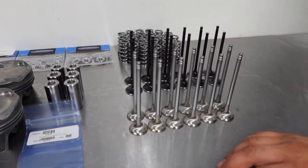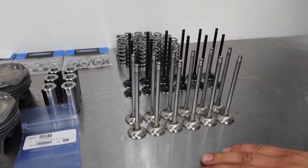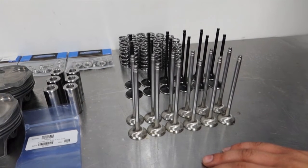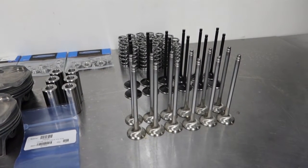The cylinder head's also being ported and having new exhaust valve guides, because they're really quite worn for a 23,000 mile engine. That's all being dealt with out in the machine shop — the head's not in here at the moment.